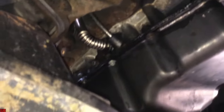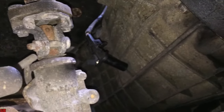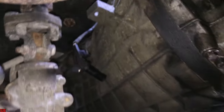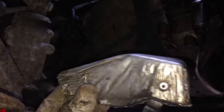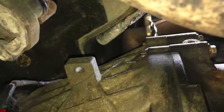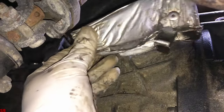The sensor is located at the rear of the engine, and at the top of the gearbox bell housing is where it's bolted into. I've pulled it out as you can see here — it's only held in by one bolt and it's this heat shield that covers the top. You slide the heat shield backwards, it's clipped in, and you just slide it back and then pop it out.